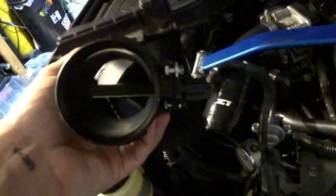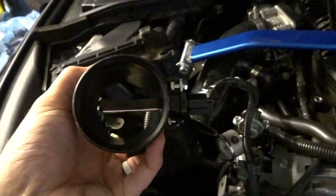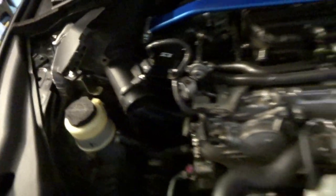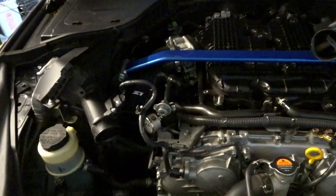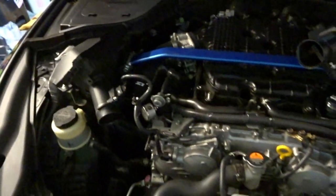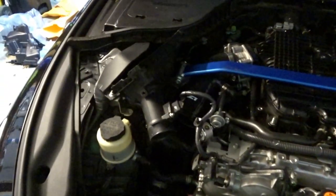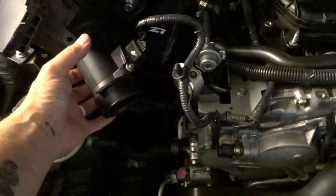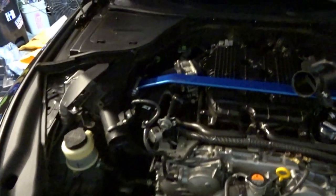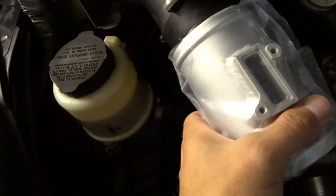Where the MAF sensor is located is the current bottleneck — this is very small, like two and a half inches in diameter. This car performs really well. Even doing aftermarket intake systems, the car just won't make that much more power with them. But if you notice, even on the Takeda intakes, the neck where the MAF sensor is located shrinks down. So we're trying out the three-incher and we're going to see how much of a difference it makes, if any.